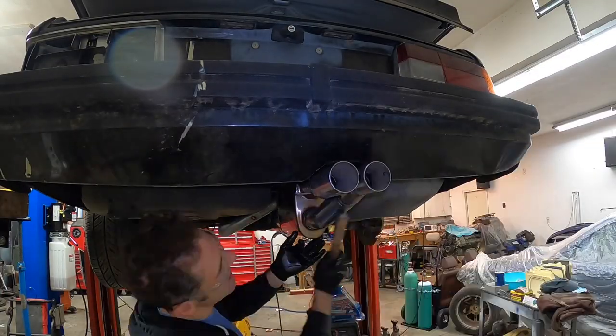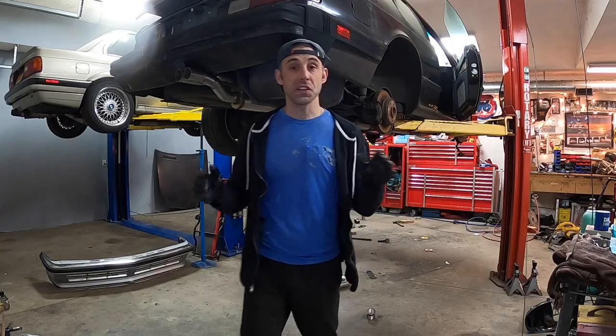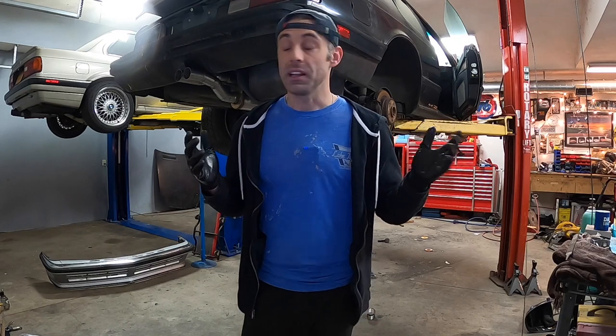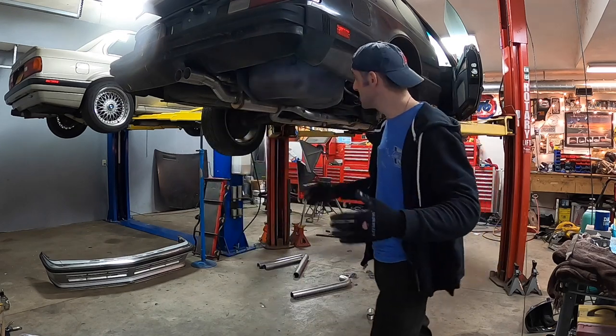The exhaust tips are now done — everything is tacked and all the pie cuts are exactly where I want them. I'm just about done; I still need to weld the entire back half of the exhaust. I'm going to use MIG stainless steel welding on the first part of the back half, and the tailpipes are all going to be TIG welded and then polished. For those concerned about the lens flare visible in the video — that's a real issue. Working closely with a stainless steel exhaust system causes splattering all over the place, and in this case it splattered the glass. Let's bring this down and see what it looks like from normal height.